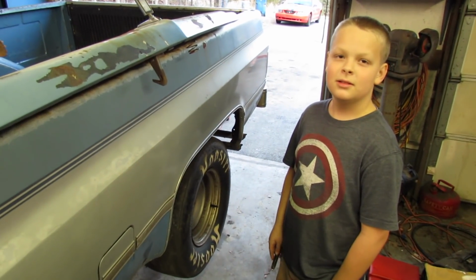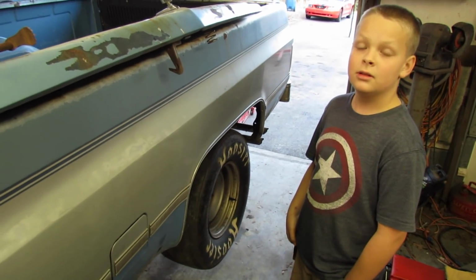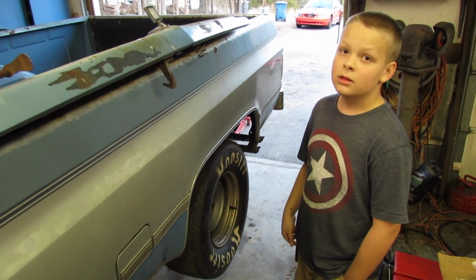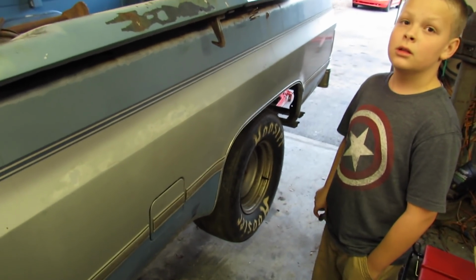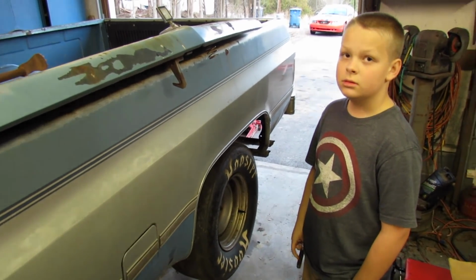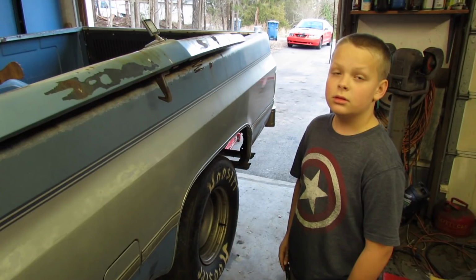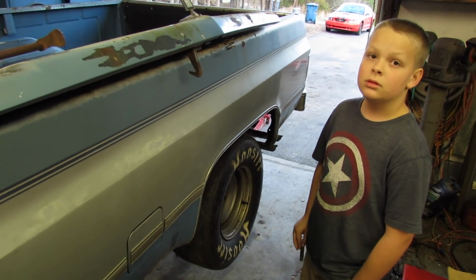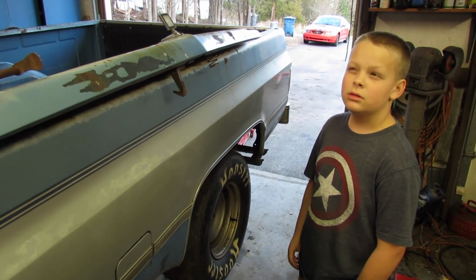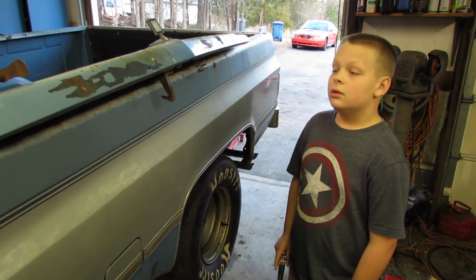You know why there's no tread on it? Because it's a drag racing slick. You don't run it in the rain. In the rain you need the tread so that the water will run inside the grooves so you don't hydroplane. You don't need that on a drag strip. You need all the rubber you can get hitting the road so it'll hook, so you're not spinning tires. You know how in the old blue and white Chevy you step on her and she lights them up? You put these tires on, it won't do that as much. They're a softer compound, it'll hook. It won't spin. If you're spinning, you ain't winning.